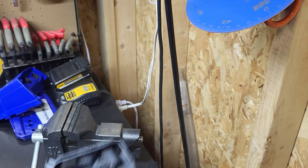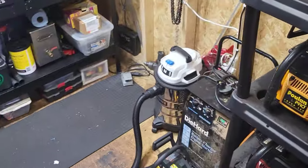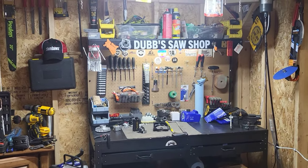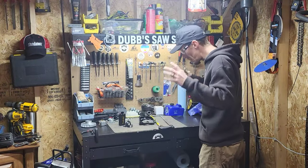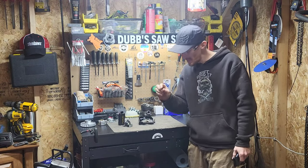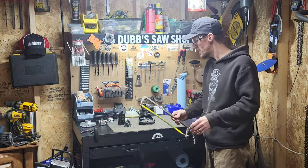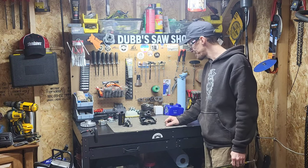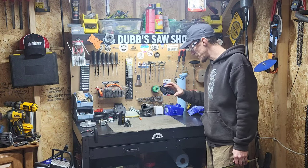When you get into stuff like this, all the little details are what's gonna keep bumping your power up. Doing your muffler mods, porting and stuff like that — that's gonna give you your biggest power bump. After that you're chasing all those little pieces of horsepower you can pick up here and there. A lot of saws it's not really worth it, especially work saws, because it takes a lot of time to finesse all this little stuff. But on a race saw where you're trying to make all the power you can, every little bit is gonna help.